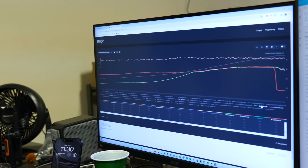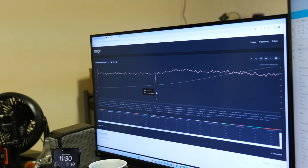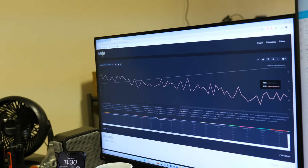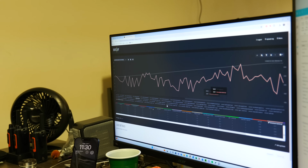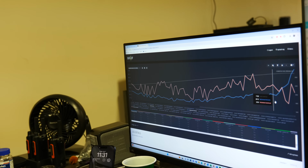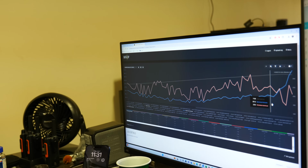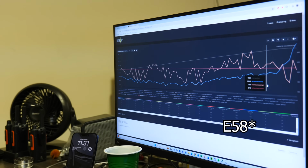Oil pressure not dropping off is fantastic, unlike some other turbos that we've seen where, because they're not ball bearing, oil pressure crashes. Now look, it's 52 at 7,300 RPM. Yeah, it's nice. Healthy. Okay, that's ugly. Can we not show that? People are going to ask, what the hell is that fuel pressure? Well, look at high pressure. At 260 boost, damn! It's at 260. That's that AMS dual pump putting in work. That's a substantial difference. Wow, what ethanol content is this? E58. That's impressive.